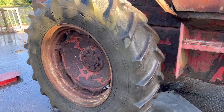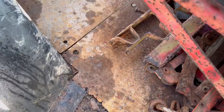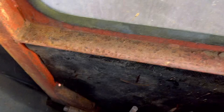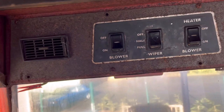Just look at the tyres — it's amazing they're still up and they've badly perished. Good Years all around, I think. Let's have a quick look inside the cab. The floor's a little bit rusty but still sort of there. The seat seems to have the original cushion and seems okay. There's a little handle there, even a seat belt. The window opens there but it's badly corroded so it probably needs a new window frame. The top of the gear stick is missing which is slightly annoying. The top of the cab is not too bad — still got the carpet and soundproofing on it. That side's badly rusted but again it's flat steel, shouldn't be too bad to do.